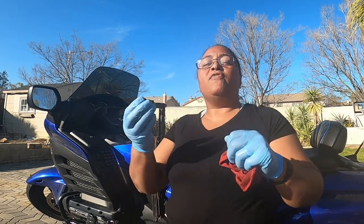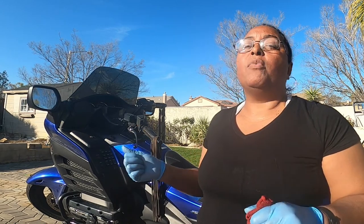I'm going to screw this back on, start my bike, and let it run for five to ten minutes, then recheck the oil after it's settled down. You want that oil to filter through the filter before you add any more oil if needed. Now that I let the bike run for five to ten minutes, I check the oil level and check for oil leaks. I'm going to go ahead and run it for five miles, come back, let the bike settle and cool off, check the level again, and check for leaks again — and then that's it. So there you have it, ladies and gentlemen — a money-saving oil change you can do yourself on your Honda Goldwing. Don't forget, tell Rich to leave my bike alone. I'm Kate with Boots and Jeans Riders, and I'm out. Peace.